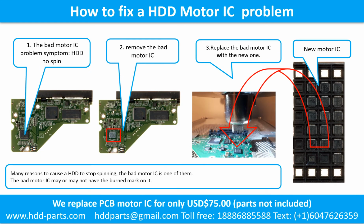How to fix a hard drive motor IC problem. 1. The bad motor IC problem. Symptom: the hard drive does not spin. There are many reasons to cause a hard drive to stop spinning. The bad motor IC is one of them. The bad motor IC may or may not have the burned mark on it. 2. Remove the bad motor IC. 3. Replace the bad motor IC with the new one.